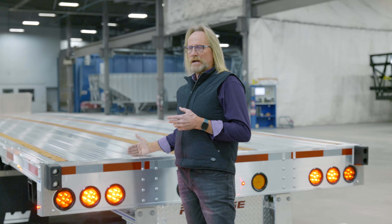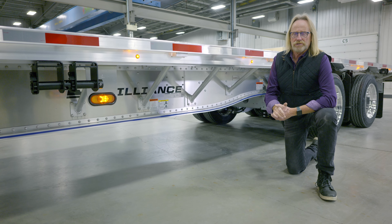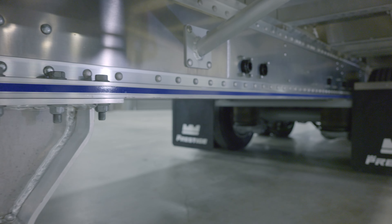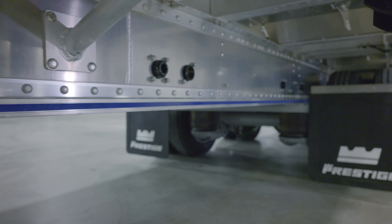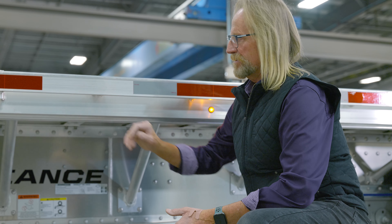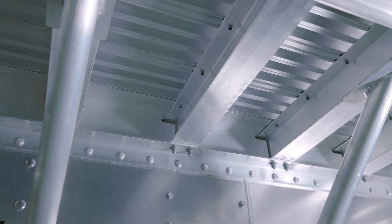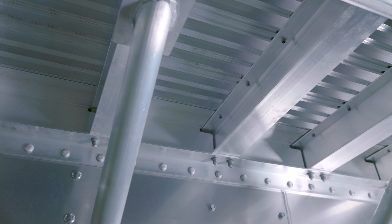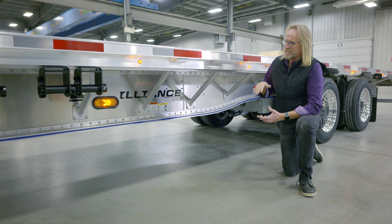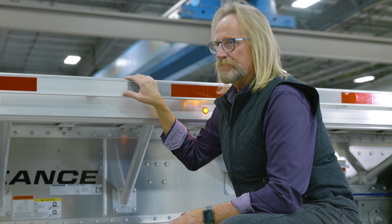There are also load bunks that you can put into the back or the center of your trailer if you want to equalize a load throughout the entire length. Regarding the beam design: we tie the upper top flange together to the bottom flange with an aluminum section that is bolted both top and bottom with Huck bolts the entire length of the trailer. We have a one and a quarter inch lower flange. The cross members run through the upper flange and are Huck bolted to the cross member as well — a very robust design with no welding, just a well thought-out build.